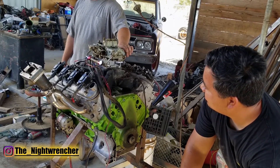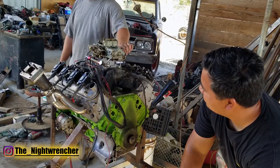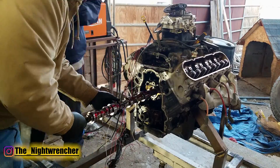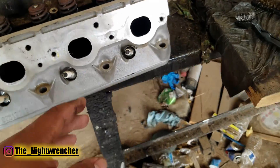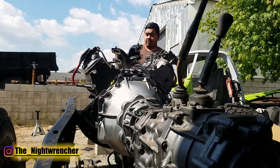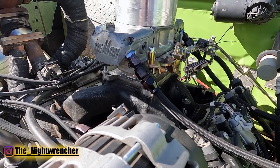Once it was time to go to the No-Name Nationals, I built a new engine for my truck — a 4.8 liter. I set that one up with larger ring gaps so I could put a turbocharger on it without any issues. The bottom end is 100% stock except for the cam, and the top end is 100% stock except for the valve springs. I've been using the same carbureted intake manifold for the last four years, and I built myself a blow-through demon carburetor.